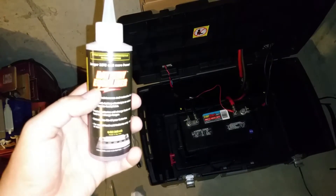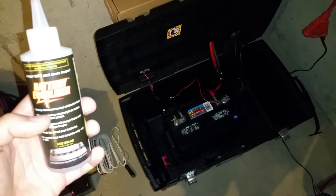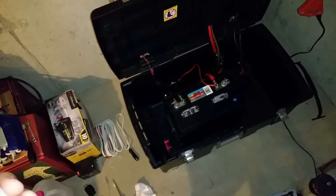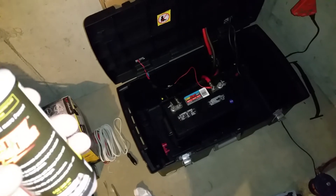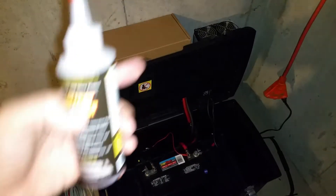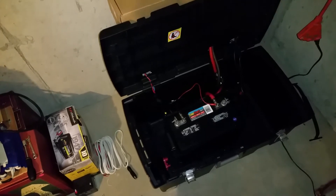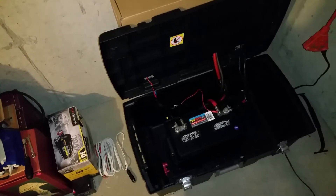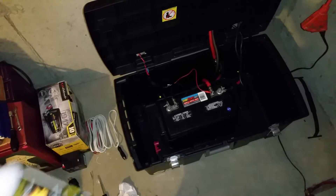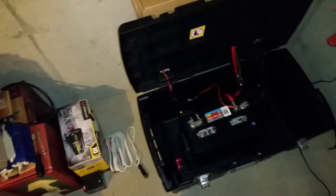I have to say this has worked really well. Originally it was 12.5 volts at rest. I put this stuff in, discharged it to 11 volts DC at open circuit, then recharged it back up. I had to be careful the first couple times because the battery would get pretty hot — the charger goes up to 14.4 volts and stays at that voltage for a period before dropping to float level. I couldn't do that immediately because the dried-up cell was causing the other cells to overcharge since it wasn't able to take the current well.